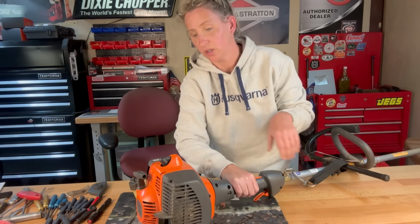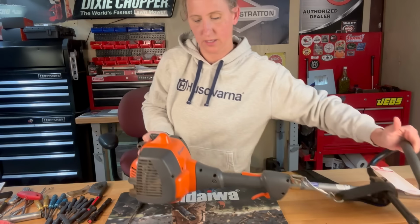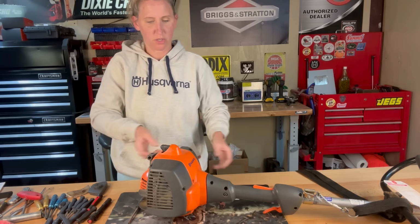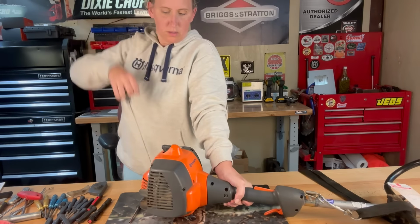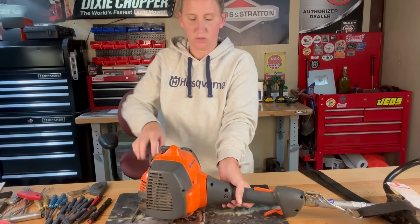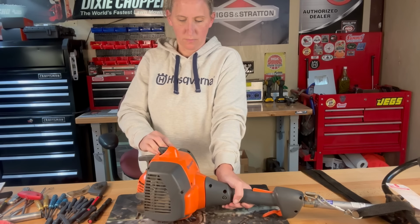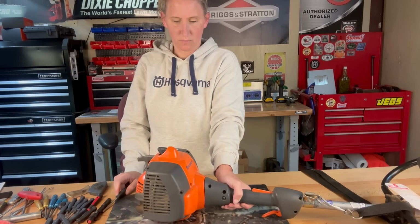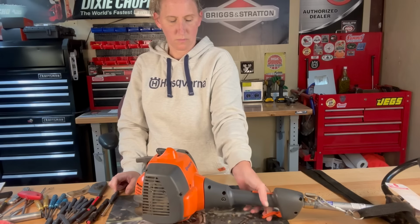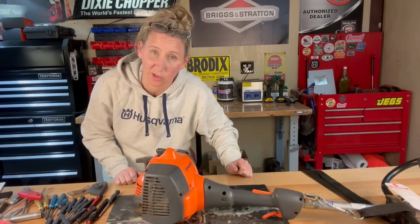Well, that's it. I took it off choke and it only lasted for a few seconds. You heard that. Let's see if we can start it again now that I've got that initial go on choke. Every time I take it off choke, it dies. Let's try it one more time. Gave it some gas, it dies. So obviously this thing is starving for fuel.